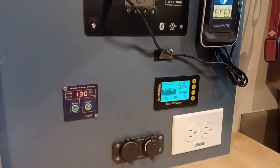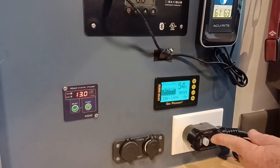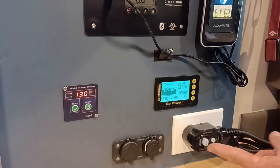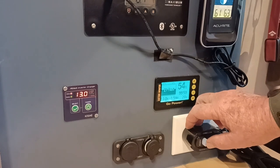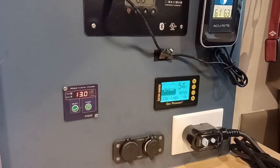I'm going to show you how to operate the air conditioning unit, but first I want to show you a problem I had with the power cord. It has a circuit breaker on it rated for 10 amps. Whenever I plug it in I test it and it immediately resets. I tried it in multiple circuits in the house — which I know are well grounded — and it trips even when it's not plugged in. So this is defective. I've found a Facebook group discussing EcoFlow Wave air conditioners, and two other people have the same problem, so there are some defective cords out there.